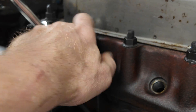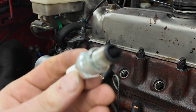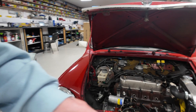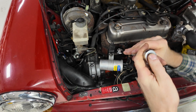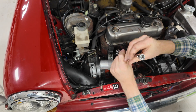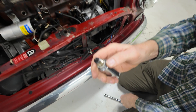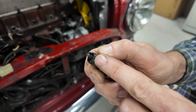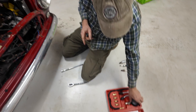The third one - let me get a better focus - looks a bit black and sooty as well. The fourth one was tight but let's have a look - the colour at the end looks okay. Sometimes if they're white, it's running too lean or too hot. Check the gap between the electrodes - they all look okay and we can check the gap with a feeler gauge.